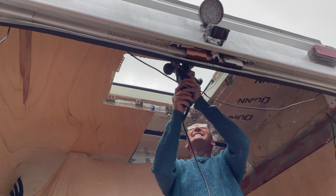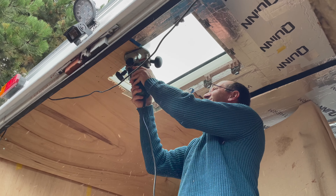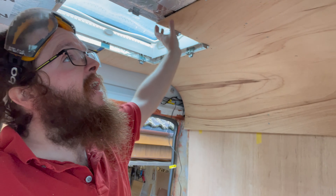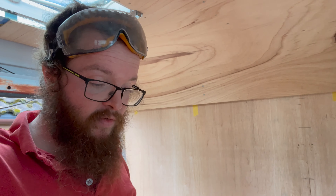After we re-cut the piece of plywood we secured it in place - we didn't manage to record putting this first one in, but we've got a longer video later to show the process. Basically what we're doing here is drilling a pilot hole smaller than the screw to guide it through into the metal panel, because we found it's triple-skinned in some places, which was causing some of the screws to snap prematurely.